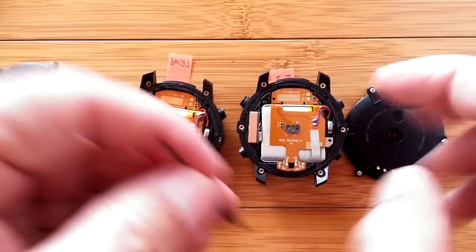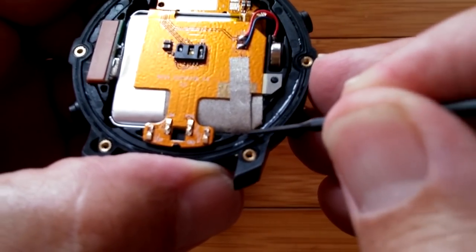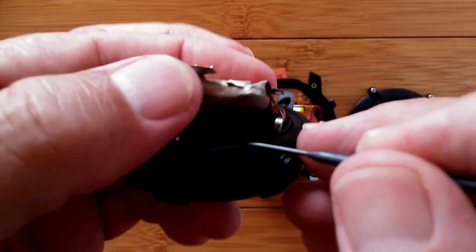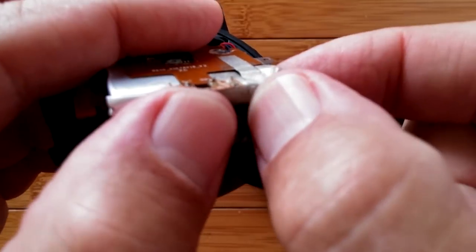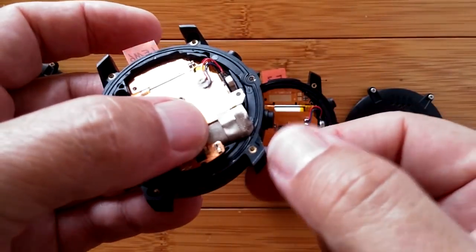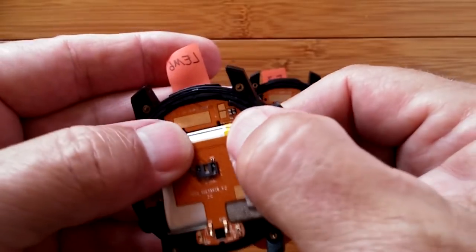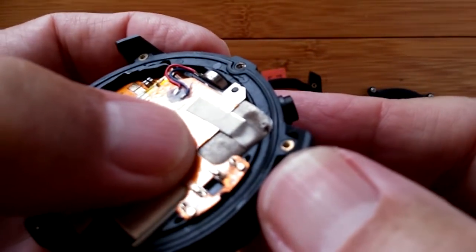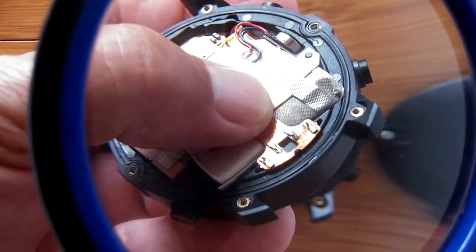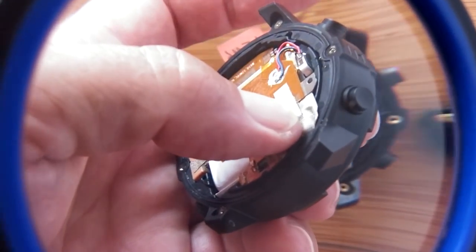We also showed you that you could take a toothpick or a little screwdriver and get in here and press that metal back down, because it's just wrapped around here — just kind of taped and looped around the edge. If you can press it down or even use some electrical tape to tape that corner down, then when you put the back on it's not going to lay over the edge. This is how mine came — open like this — so it was over where the gasket goes and inhibited the seal. The screws were tight but water got inside when we did the immersion test.